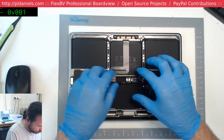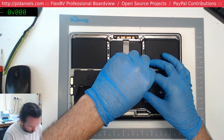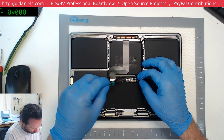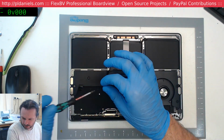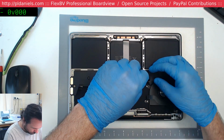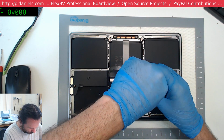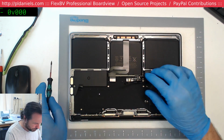Yeah, I think the first thing we'll do is make sure we disconnect this properly. Obviously the main board is out, so that should the very worst happen and I have a slip or something goes wrong and the battery decides to go pyrotechnic on me, then I can just throw this thing out the window and at least the person's data will be intact on their motherboard. So there's no motherboard in this. It's probably always a good idea to do that by default.